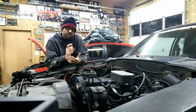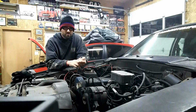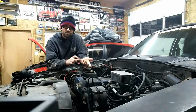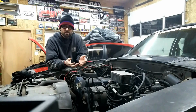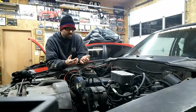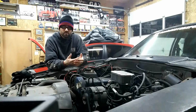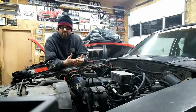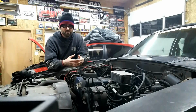So I've got to take the engine oil out. I'm going to take the transmission oil out, and that's just for the matter of when I take them out, I don't want them leaking through any seals. As you tip the transmission, it will tend to leak oil out the back seal. Transmission already is leaking enough, and so I've taken up all the plastic that was under it and everything that I had. If you saw through the subframes and that, I've taken all that out. It's all back down to concrete because I want this to be as clean as possible.